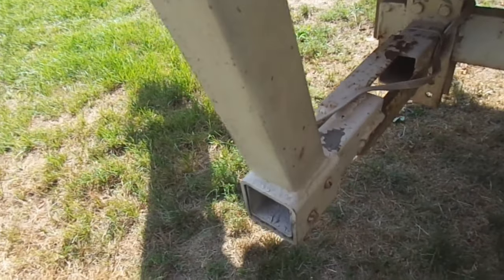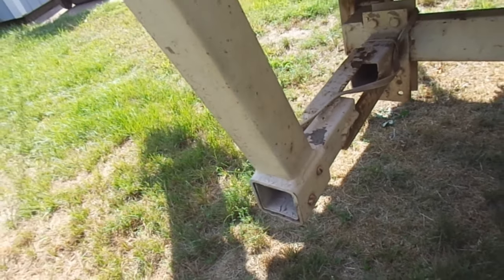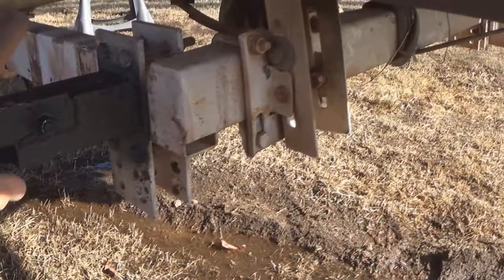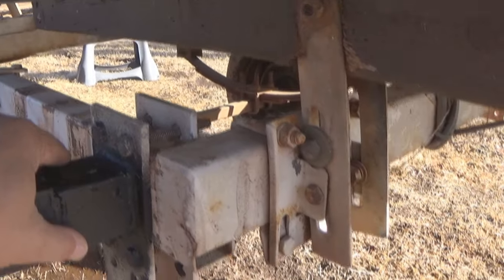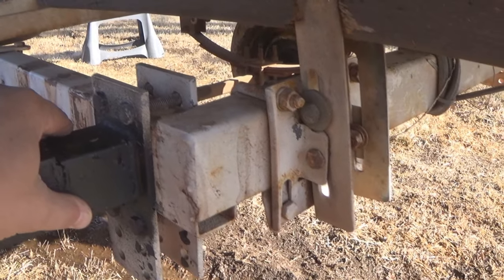These tail lights are mounted on these upright roller guide posts. And even if I have the taillight grounded really well to this upright post, I'm not sure that the upright post is grounded really well to the trailer frame. It's just been bolted over many layers of paint, and I just don't want to trust that to be a good electrical connection.